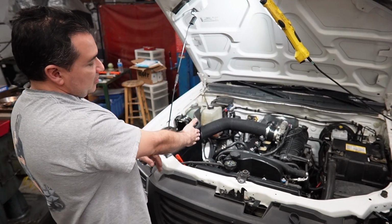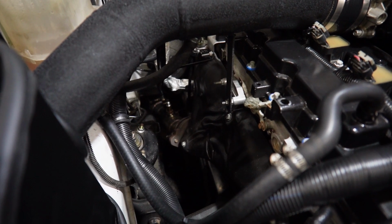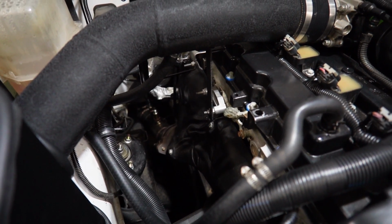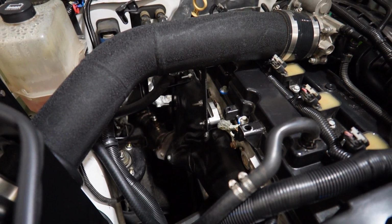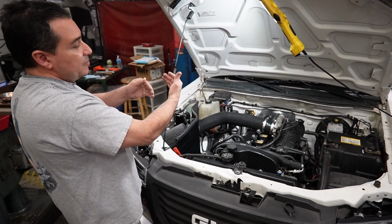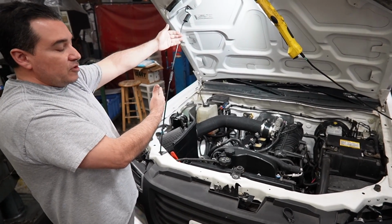Now you got to worry about the exhaust. The stock Trailblazer cat pipe bolts right in. Fits right on there. Clears the firewall, doesn't hang below the frame, almost like it was meant to be. And you only adapt maybe about 1 foot on this standard cab to the catback exhaust from the Colorado.